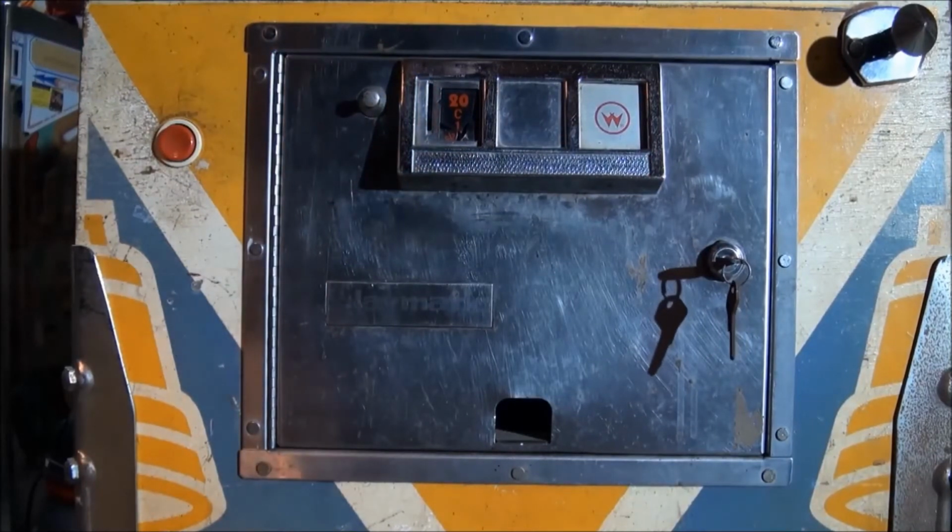And another note about the Williams type mechanism, from the 60s right through till the end of production in 1999, the Williams moulding and the latch mechanism to secure it remained exactly the same. So for example, you could take the moulding off a 1972 Doodlebug pinball and it will fit straight onto a late 90s game like Junkyard or No Good Gophers.